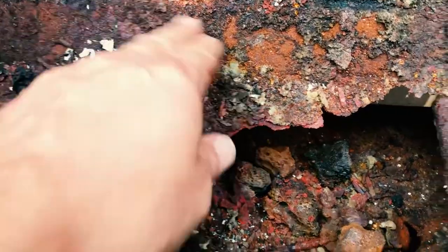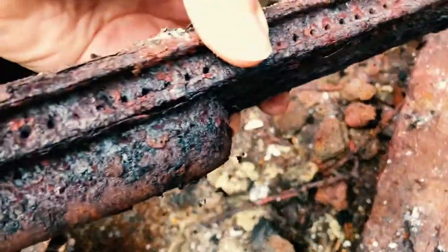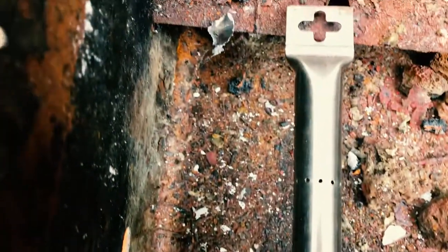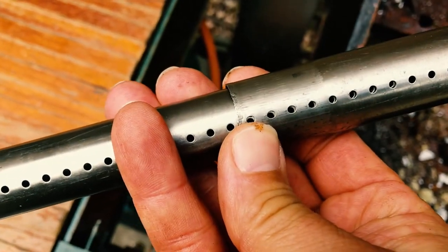These supports used to hold the burners and they're falling through. That side's okay. There's a lot of work to do here — we're probably going to weld some steel in. Let's take this one out — that's the diameter I need. It's reasonably similar to the gas distribution bar. We'll need to extend the length of it, get some angle iron and weld onto that. For now let's leave it at that sort of length. Once I arrange it so the holes line up, let's tighten them up.